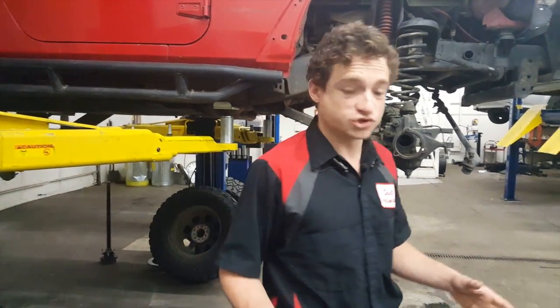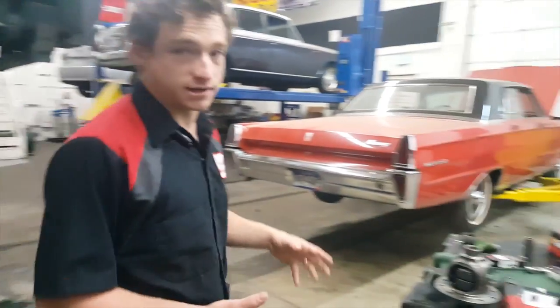Because this vehicle is in the air with the front tires rotating, when it came into contact with the ground and that static traction load, that coefficient of friction suddenly applied to both those sides, ruptured both U-joints, tried to transfer that power across, and broke both those axle shafts. To stop that from happening in the future and to help ensure positive traction from both front wheels, we're installing a Lock-Right locking differential.